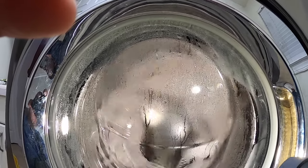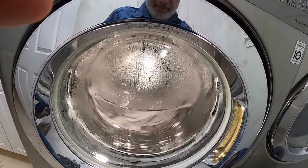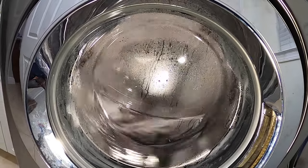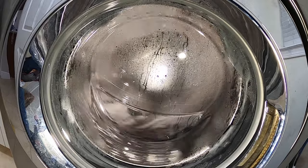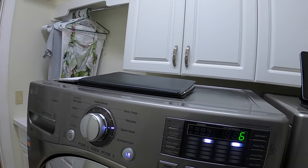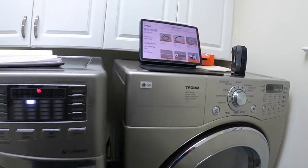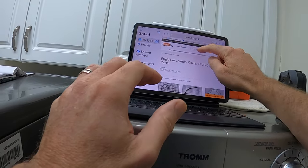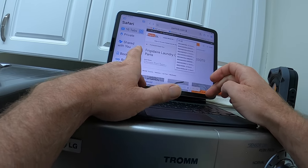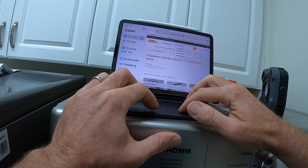We took a load of four towels, put them in, and ran a speed wash — a full 15 to 18 minute cycle. It drains, but when it gets to the high-speed spin you can see it wobbling, trying to ramp up but never reaching full high-speed spin. It stays at six minutes left. You'll hear it drain, then it tries to balance the clothes by tumbling, then ramps up to try to spin, stops, drains a little, and ramps up again. You can see it shake and hear it limping because there's too much shaking in the drum.